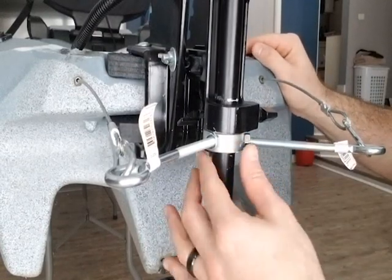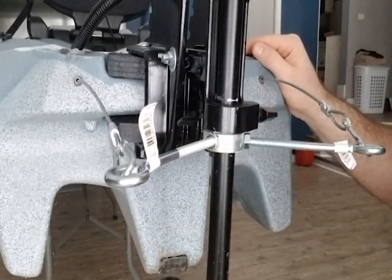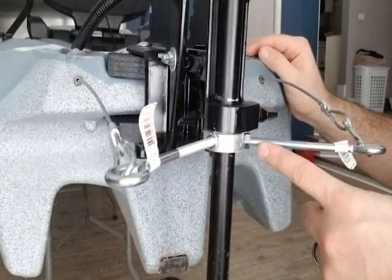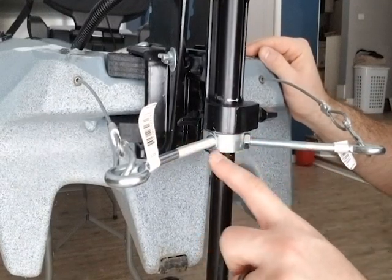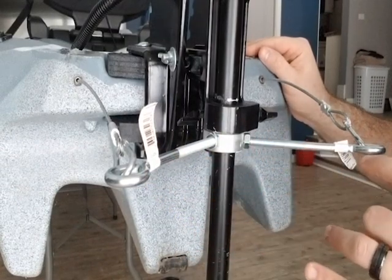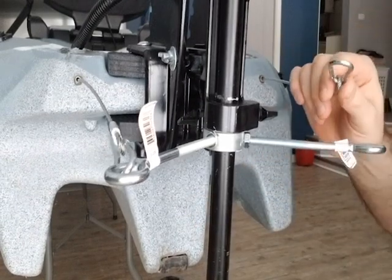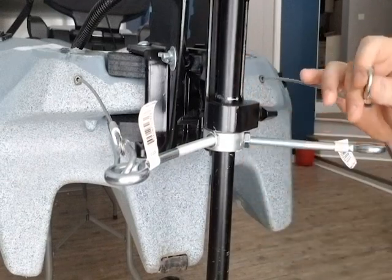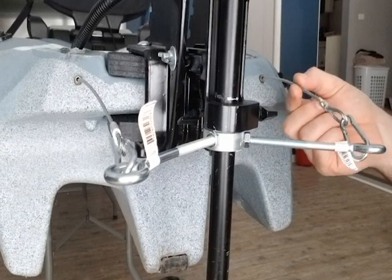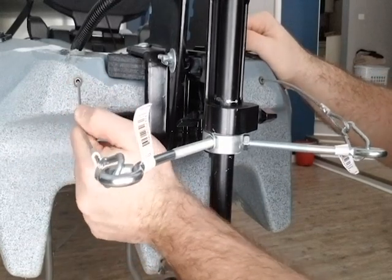First off, I took this galvanized steel circle — I'm not exactly sure what it's called, I found it at Ace Hardware — and it just fits right over the shaft, tightens down with an allen nut on the back. I pre-drilled and then tapped 5/16ths for these eye bolts into this steel. Off those eye bolts — these are 6-inch eye bolts — I just hooked these carabiners to it. The carabiners are specifically for taking off my motor. And to the carabiner, I'm running what I think is 3/32nd galvanized steel cable, and that runs all the way up to my foot pedals.